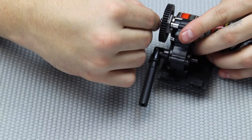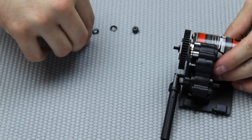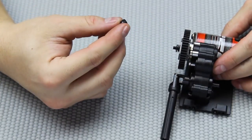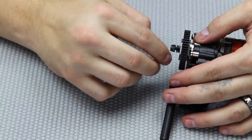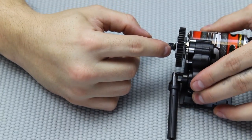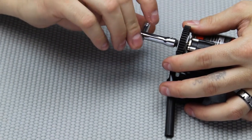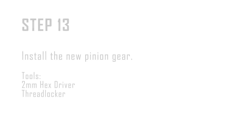Then install the five washers. The five washers are concave — they're kind of bowed or coned — and they have to be installed in a specific order to act as the tension or spring, in order to increase or decrease the tension on the slipper clutch. The first concave goes against the metal plate and the second one goes away, then you repeat that process vice versa — the third one goes towards the plate, the fourth one goes away from the plate, and the fifth and final one goes back towards the plate. This creates a spring reaction between the washers. Once installed, you can see the variance between the different washers and directions that the concave faces. With the lock nut on, tighten this down — tighter or looser adjusts the tension on the slipper as you experience different slip in the center transmission.